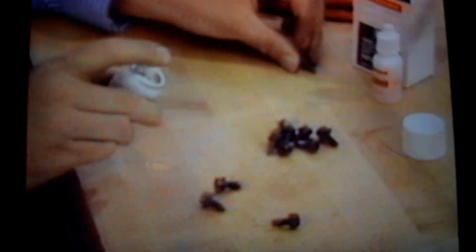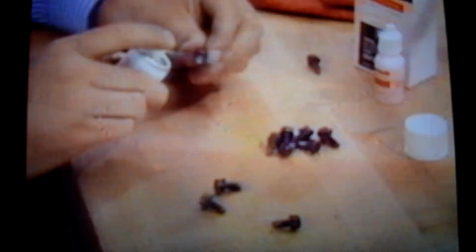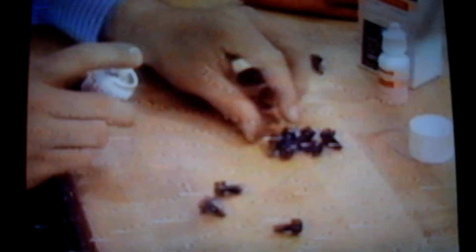Other fasteners require the use of an adhesive thread locking compound designed specifically to prevent loosening. Like thread sealer, thread locker works by filling the spaces between threads. The difference is that thread locker is an anaerobic adhesive. The term anaerobic means it cures when removed from the presence of air. Once hardened, it forms a rigid bond and prevents the threads from moving.